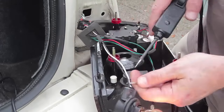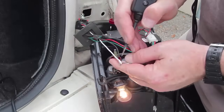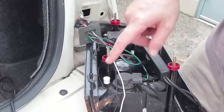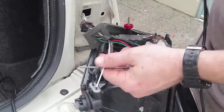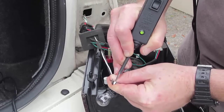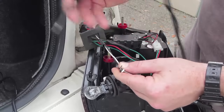I can verify this here is going to be my ground. You can't have a ground circuit without a positive circuit. Now here's a little note about reverse lights: if you're testing this with the circuit off, both wires are going to rest at ground — and I'll show you that. Right now the car is in park. Going back to those same two wires — black is my ground, it's resting at ground, and so is the white. When you switch into reverse gear, this wire is going to go from resting at ground — because it's getting ground from the filament feedback from the negative side — but when you put the car into gear, this wire is going to go to 12 volts. You're going to have ground and you have a light circuit.